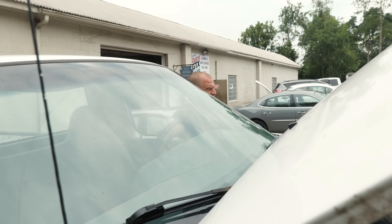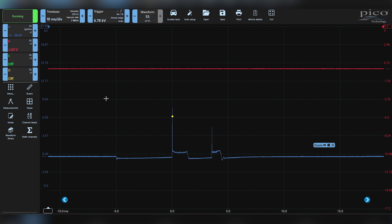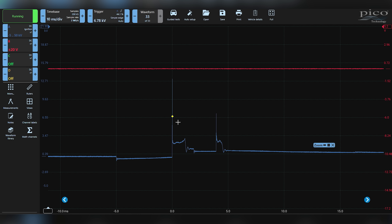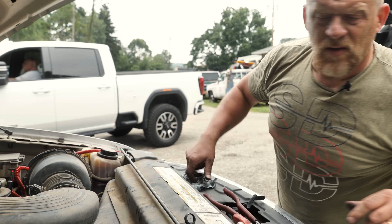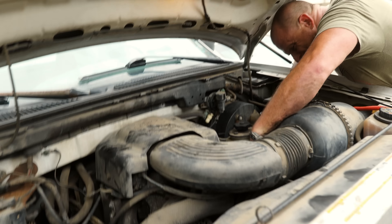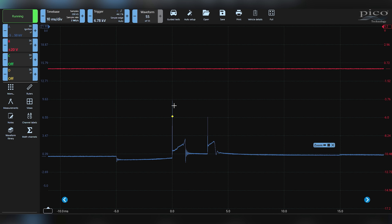Fire in the hole. What am I connected to? That's my number five — it's not arcing anymore because I moved it. Let's move this to the number six. Yeah, it looks good. And then I moved that to number two, so number two is on this coil. That's where we're going to see our shitty pattern again. Move this over. That's the number five arcing again. That looks good since I moved it.